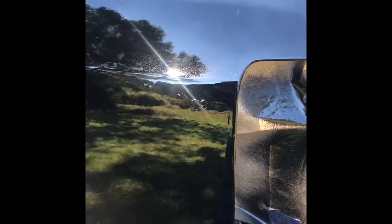I'm gonna take and scratch them off with a razor blade and resand it and respray it, because I messed up pretty bad on this side. Sometimes stuff happens. I had too much paint coming out of the gun, and I was too close, I believe. Looking back at the video, it looked like I was getting closer on this side than the others. So I'm going to take and fix that.